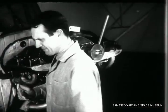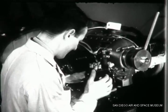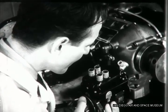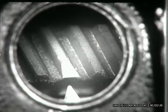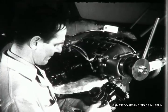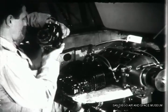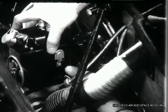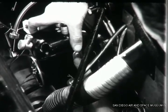Before placing the magneto on the engine, check again to be sure the breaker contacts are at the point where they open. With the two marks lined up, the magneto is adjusted to send a spark to number one cylinder. Now mount the magneto on its studs and run the nuts down finger tight. Exact timing is obtained by turning the magneto in the slots in the magneto flange — leave the nuts just loose enough so the magneto can be turned.